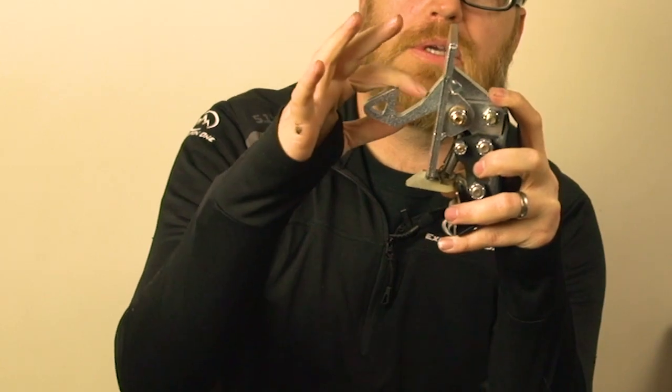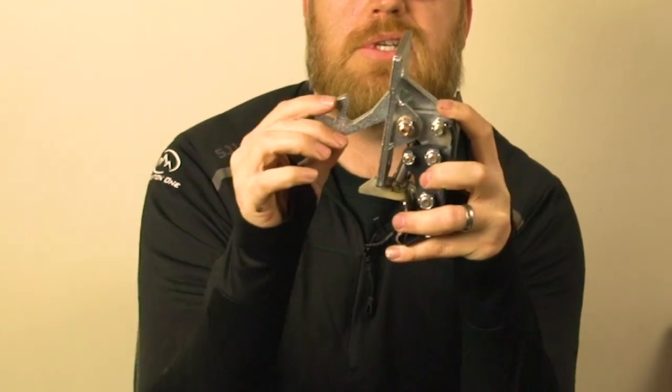This is our main hook that we've devised. It has this very unique sloping shape to it, designed so that once you've opened and fully cycled the mechanism, when you're closing it, it will transition down and be able to lock back up on your hook mechanism, and then you can actuate it all the way and tighten it.